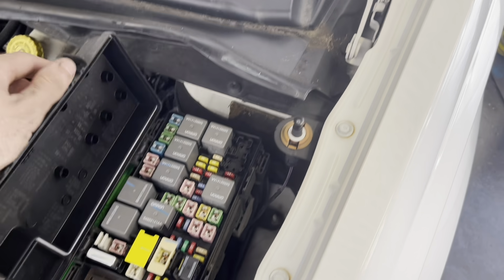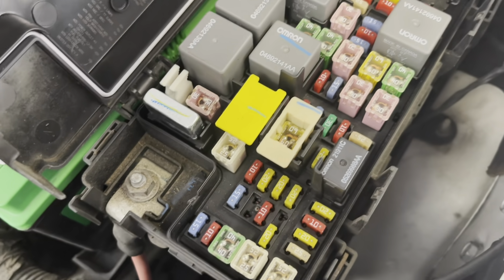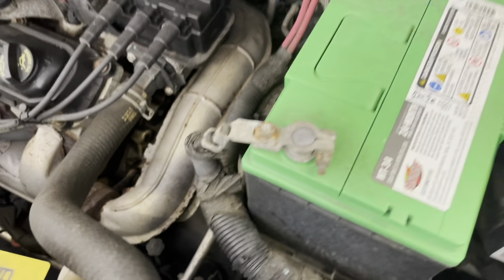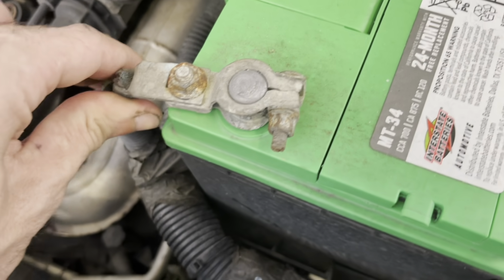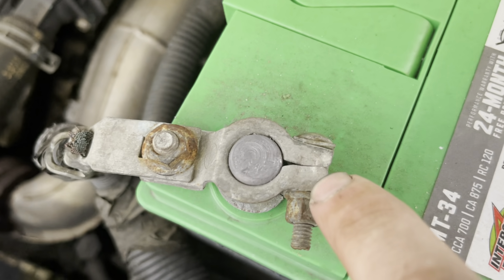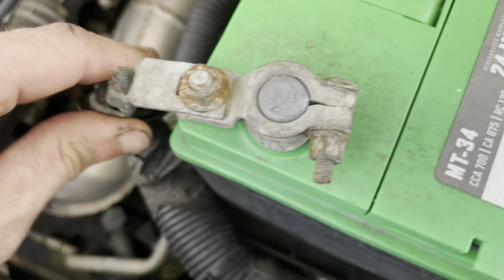And I went, yeah, hang on a minute. Let me reevaluate this thing and see what I got. Yeah, this I think is what they call a TIPM. That being said, I went straight for my number one electrical diag procedure, and look what I found right off the get-go. Over torqued terminals where they bottomed out, the lug here is stretched and this is loose.